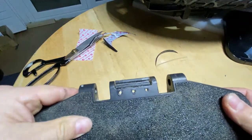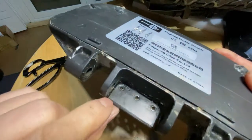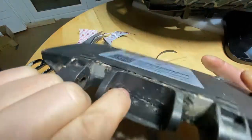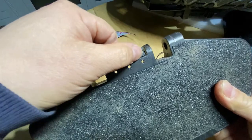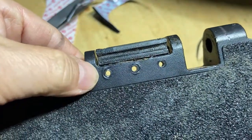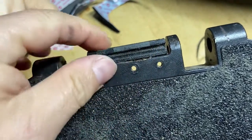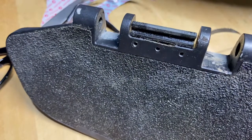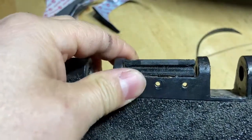As you can see on my foot plate here, there's this piece of plastic which I made from the 3D printer. It's a piece of solid plastic, 100% fill, and it goes all around on this plate, so it sits onto this Kingsong plate, where that bit usually gets snapped off. If we look closely, there you go, that's what it looks like. That's where the original metal plate is, and it snaps off. So I printed this plastic clip on the back and glued it in. And then you drill 3 holes through there, and then use the screw.